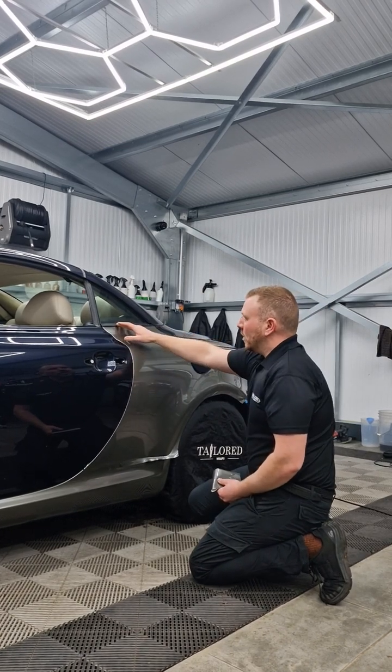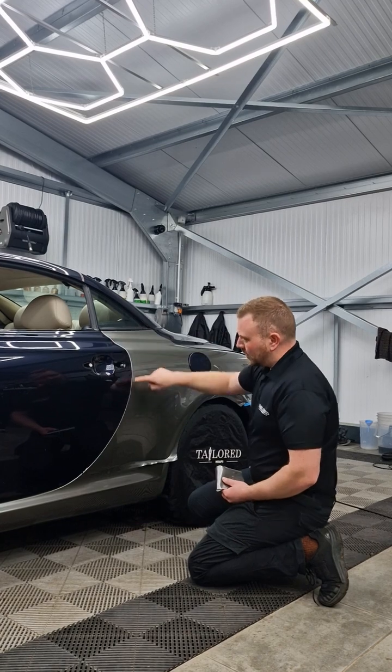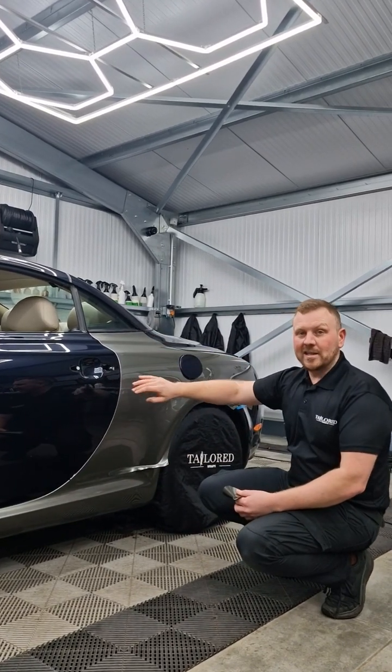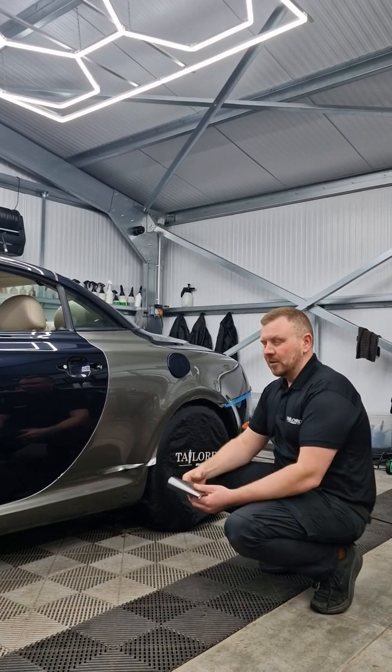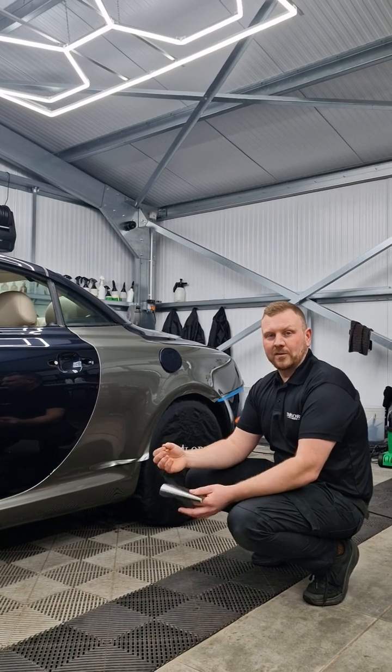With a hybrid install, I've left the top, the front, and the top edges here, and this front edge has stayed dry during the install. That means I can wrap them instantly, and where I've let the water come out is here at the bottom. This film does not like to go around the edges if there's still water there. You have to let it dry.